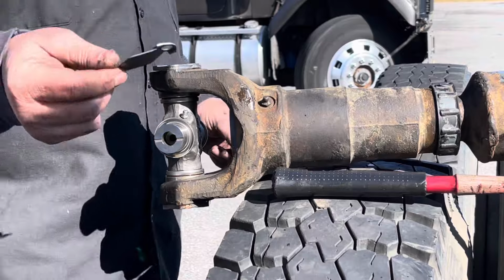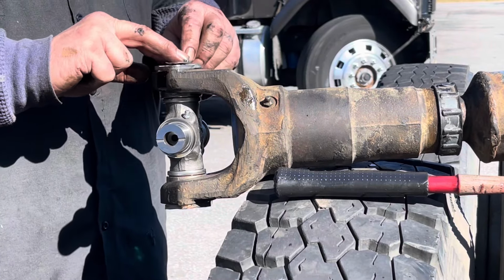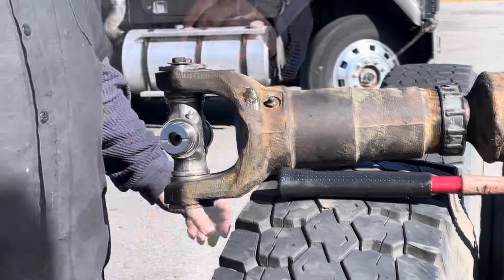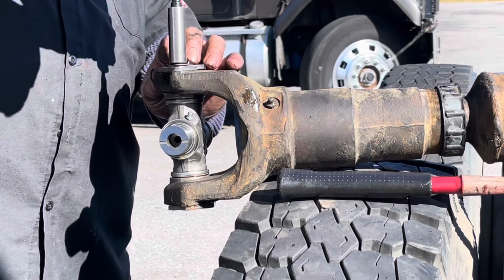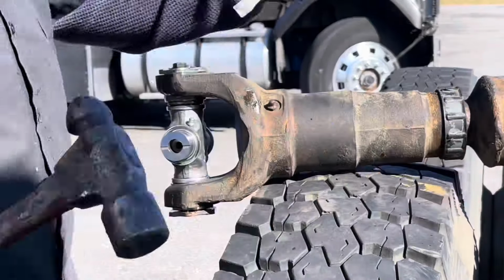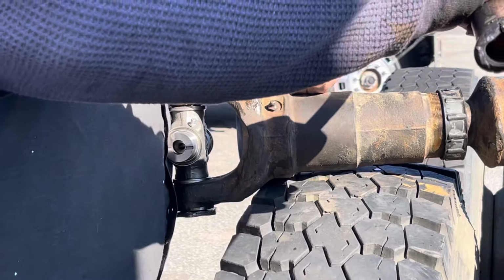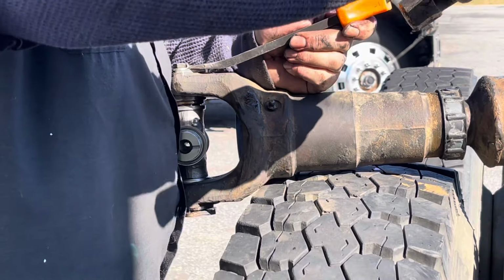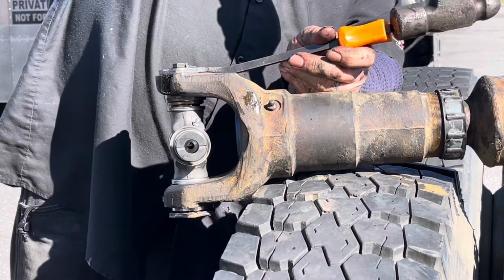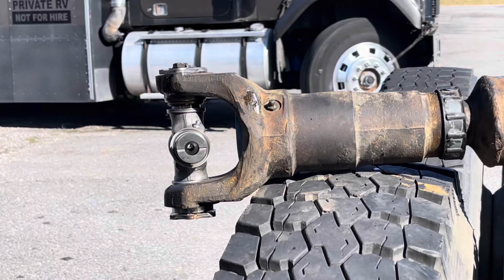So again, here, the lock plate goes on. Then you install the 2 fasteners. Zip those down. Then you just take a punch and fold that tab up so it's against the head of the bolt. Those bolts will never come back out.